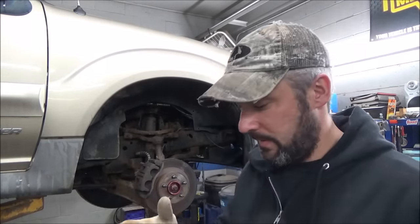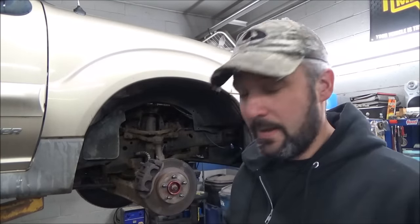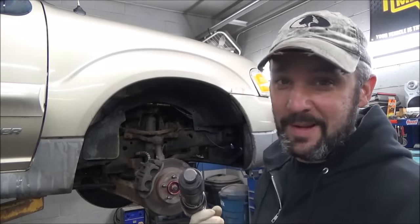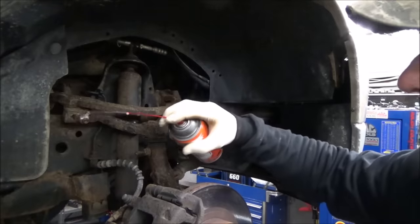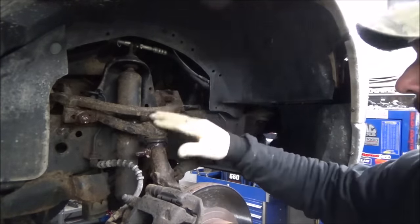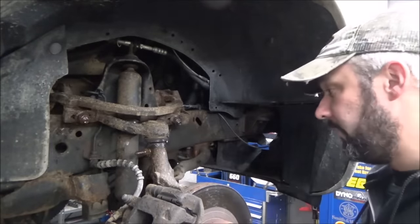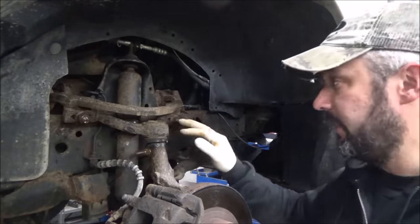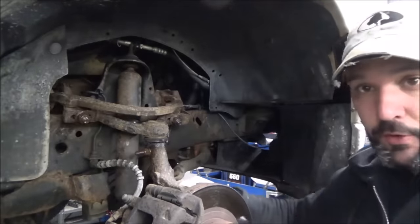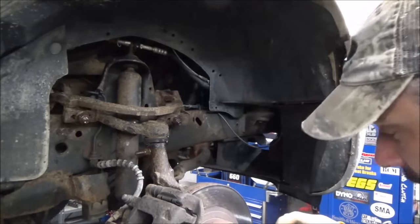Basically everything I've hit with it has popped off in like one little whack, so I thought we could mess around with this — it's a new tool and that's fun. We got everything hosed down here. On the right side all we've got to change is just this little short arm. You can actually buy a whole new arm on these explorers, but we're just going to do the short arm. It's also got a broken sway bar link, so we'll fix that, and put a lower ball joint in.